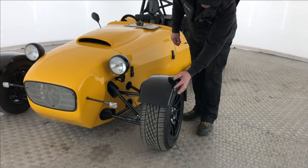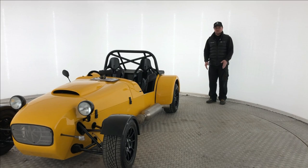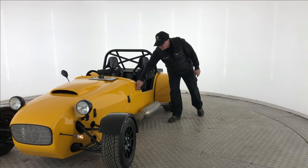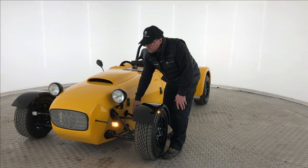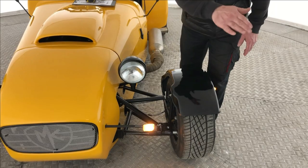Something else on the indicators: we have the ones here with measurement, but also this small one on the side of the wing. This is called the five-degree angle test from the rear of the vehicle — you need to be able to stand at five degrees from the vehicle to see that corner indicator illuminating. It has to be fitted on the front wing so it can be viewed from five degrees. The main indicators must also be at the front of the vehicle — you cannot set them back — because from the corner at 45 degrees you must be able to see them.